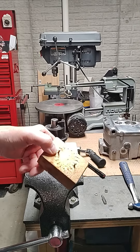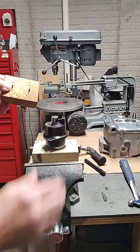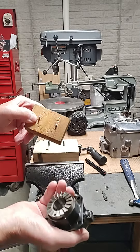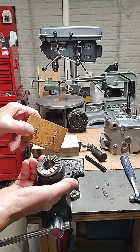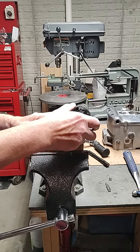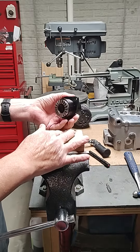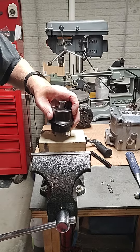The shop manual shows that you should put two nails in either a block of wood or your workbench in order to wind up your kickstart assembly, to fit the spring and fit the kickstarter to it. I've expanded on that just a little bit — I've got the same two nails that are going to go into these holes.